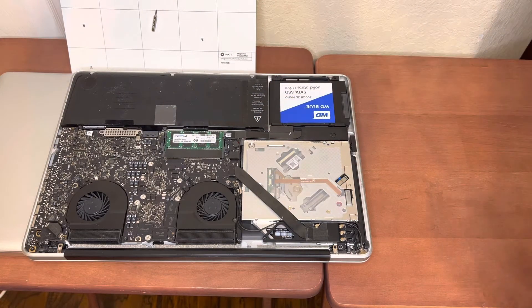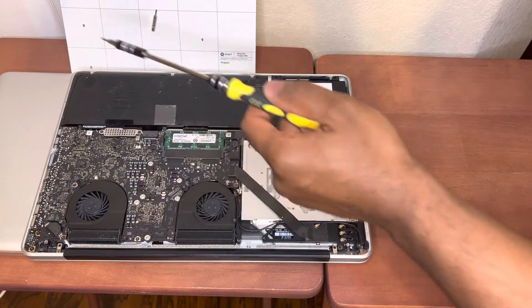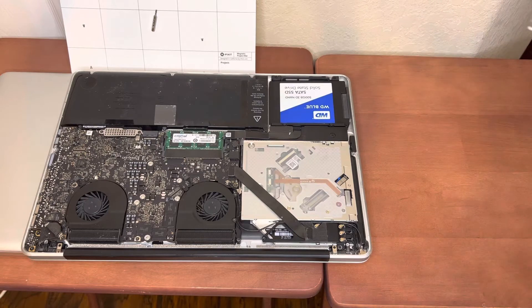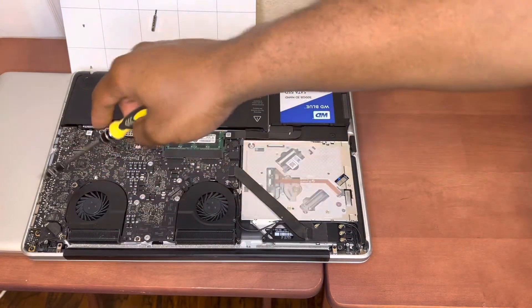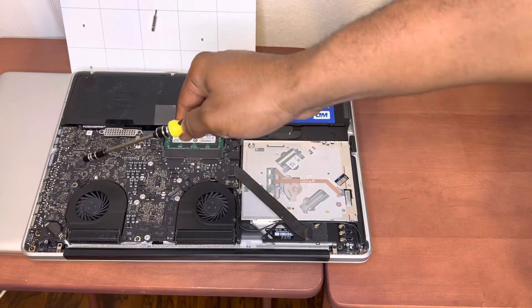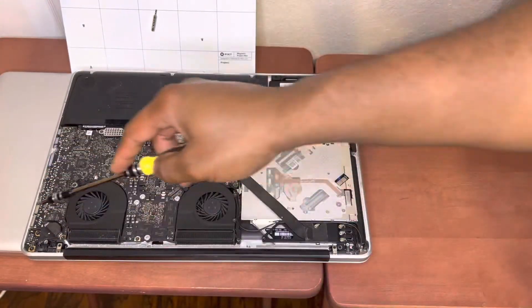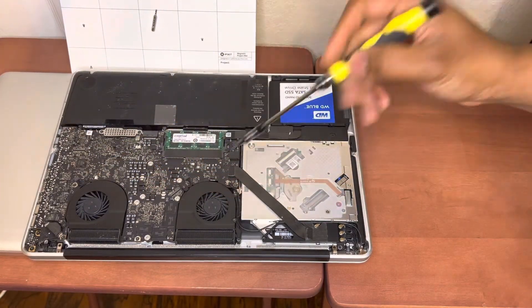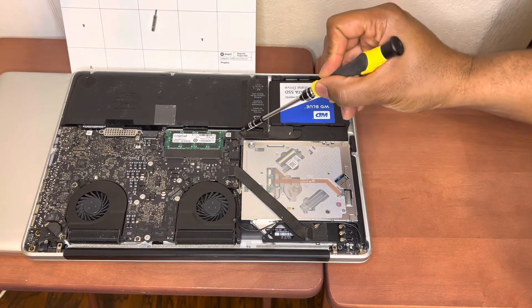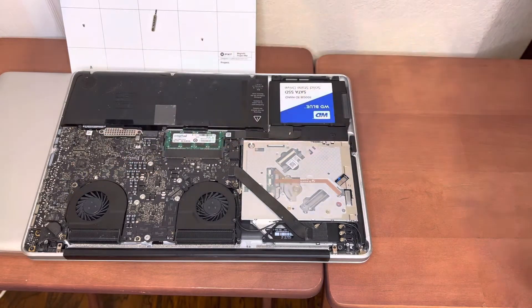Taking everything apart was super easy. Putting it back together — there's a clip-on plug and a ribbon to watch out for. I did the first laptop, took my time, knocked it all out patiently. Once you pull this up and flip it, there's another cable — don't disconnect it. You're going to lift it and pull it; there's a plastic bar that will get stuck on a screw, so lift up and wiggle and it'll come off. There are more screws on the motherboard — one here, one under this ribbon — they're all gold or bronze colored, easy to see. You'll have it all taken apart in about 10 minutes.